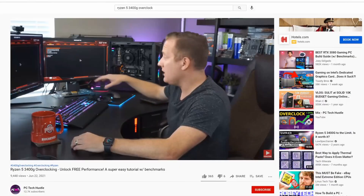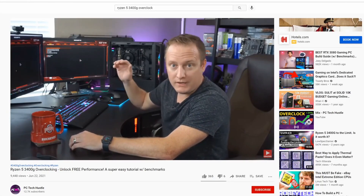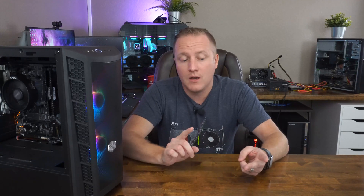The good thing here is we now know we have a system and a motherboard that supports it. Lucky for us we still had our 3400G system sitting right here — just swapped the CPU and away we went. If you want to copy what I'm doing here and you have a 4700G by some means — maybe you bought one of the HP systems — I'll have links in the description below. The great thing is we've now unlocked the CPU, meaning we can apply XMP profiles and do overclocking.